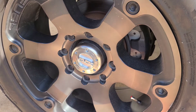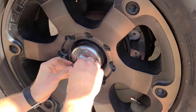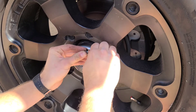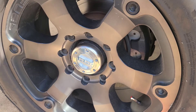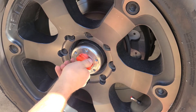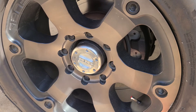All right, that is pretty much it — you are officially done installing your manual locking hubs. Now if you want to, you can go ahead and block off the vacuum line port under the hood on the left hand side. Whether you're using a diesel or a gas, it's going to be pretty much in the same place. I would recommend just blocking it off there and leaving everything in your knuckle assembly alone, because you don't want water getting in. If your vacuum lines are totally gone, you can install just a little plug. Then you can test your hubs — make sure they work. If you've got your truck lifted off the ground, you can turn the wheel and see if it's grabbing the axle. That is pretty much it. If you have any questions, put them in the comments. Thanks for watching.